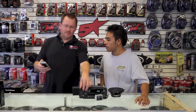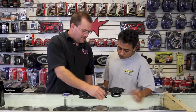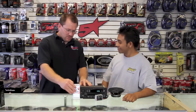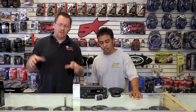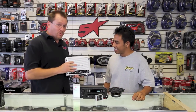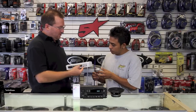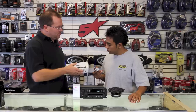So we can change tracks from here. But what we can do now is these RCAs that you have right here — these are outputs. I know last week they were inputs — I screwed it up — but these are actually outputs. So what we can do now is if you have like a boat — like Manuel's boat — we can take that, and Manuel doesn't want to cut a hole in his dash. So what we do now is we take that output and we just so happen to have this Rockford four-channel marine amplifier right here. This amplifier has a front and rear left and right input, and on this particular amp it has a two-channel/four-channel selector. So we put it to two channel, we plug that in, and that will feed all four channels sound.